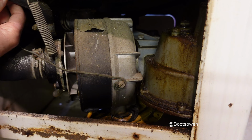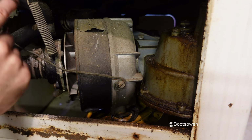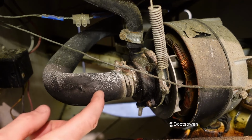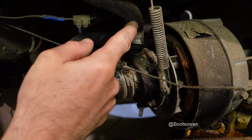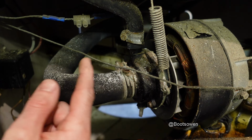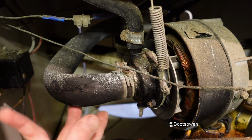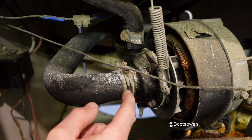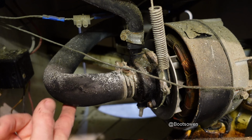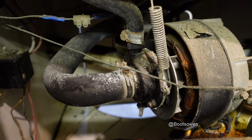I'm just hoping these hoses, you can see cracking in it. I'm hoping that it'll work, but that should be easy enough to fix. So this hose here from the pump, you can't see that at all. So looking at these pump hoses, the one that goes out, there's some cracking in it here. It just goes to a hole in the side of the tub, and then you put in another hose from the tub outwards, which is its own design, and that's okay. But I'm reckoning this here looks like a 1 1/4 inch, 30 mil, something like that hose, and you could get a bit of flexi rubber, take off the hose clips and put it on. Likewise for this one, and access is quite easy. It's all in front of you.